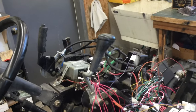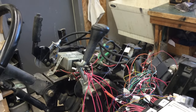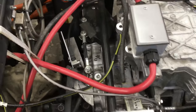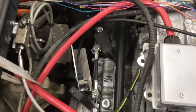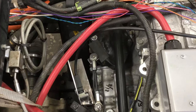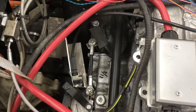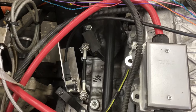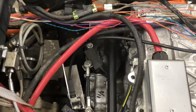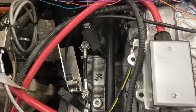This lever was the original shifter for the transmission gears, and I've converted it to the park feature — a mechanical park feature. The park engages by cable from the original shifter, goes through a bell crank mechanism, and ties into the park feature, which was originally electromechanical but I've converted to manual. There's also a micro switch in this black box just to the left of the universal joint rods, to ensure the park is off before you can shift gears — otherwise you'd cause chaos in the differential where the dogs engage for park.